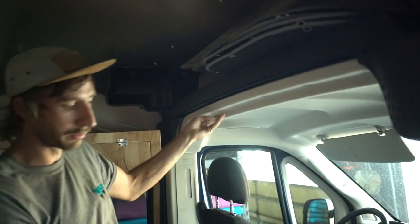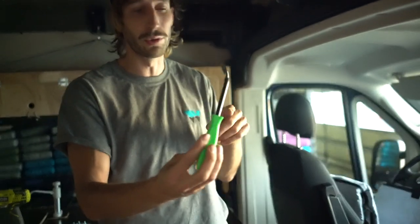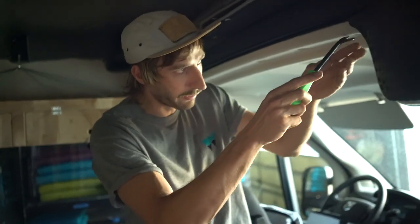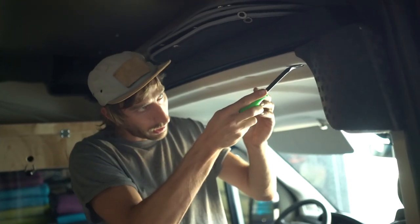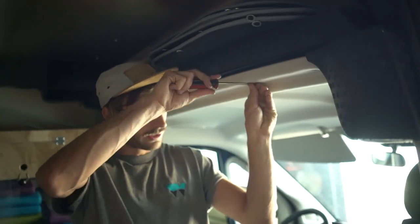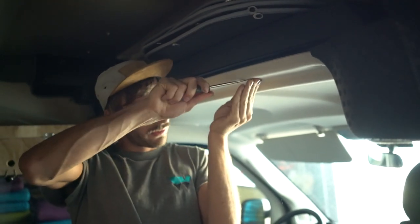So the first step is to remove the rivet — I'll remove three of them. We use this very specific tool called a bone tool. You can get it at your local automotive store. It's to take plastic plugs out — they're called trees in the biz. It holds both sides and you just leverage that guy straight out. Usually they come out in one piece, sometimes they're ugly. If you don't want to buy this like $8 tool, you can use a screwdriver and just work either side of the rivet kind of slowly.